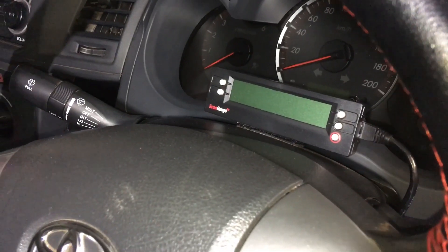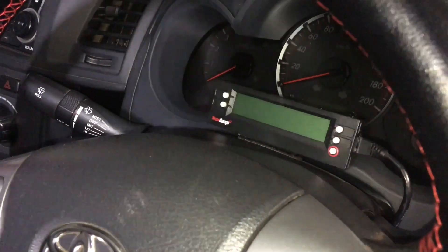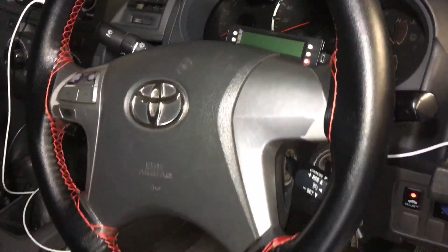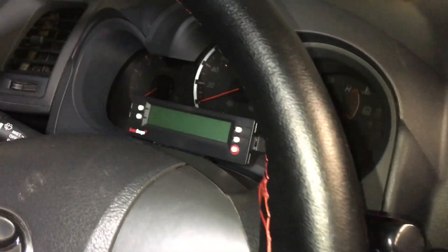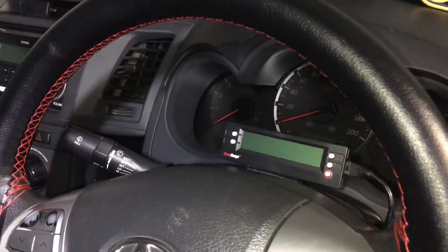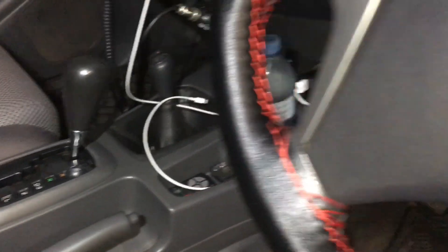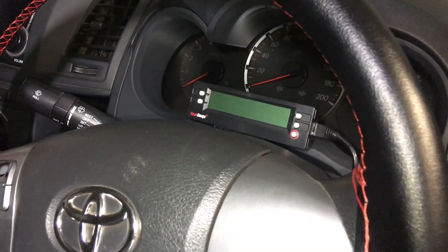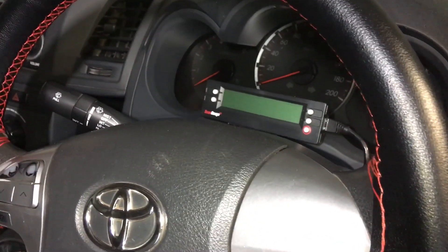It doesn't bother me what brands and products you use. We've had this scan gauge from years ago — back before you could just plug in a little OBD device without running a wire. I've left the scan gauge in the Hilux because the Hilux 4-speed automatic transmission is the one that slips the most. It's got the transmission temperature — we've put the codes into this scan gauge so it can read the transmission temperatures of all the Prados and Hiluxes throughout the whole range, as far as we know.